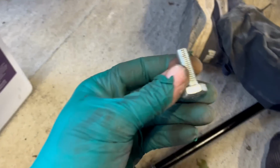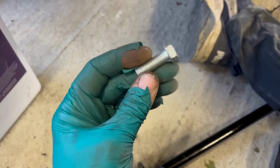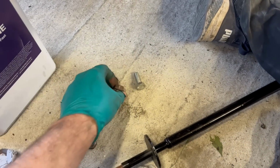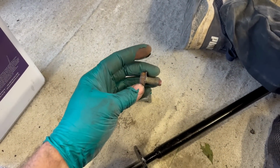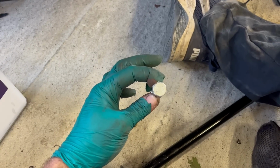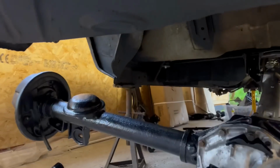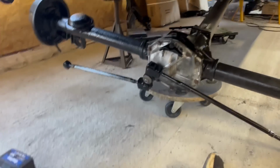I do have 4 of these nice new M10 bolts, but they're only 8.8s and they're not locking or thread cutting, whatever you want to call it. And if I fit those and then later buy the right bolts and come back to remove these, if the fuel tank's in, getting access past the fuel tank to those bolts on that side will be a right pain in the bum. So I'm kind of twiddling my thumbs, wondering what to do.